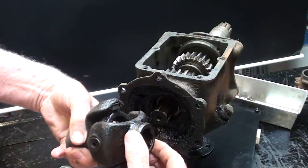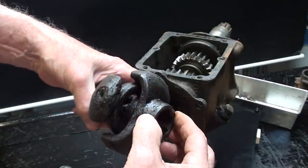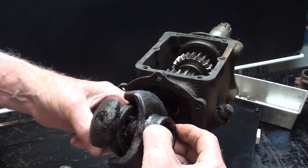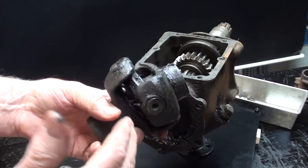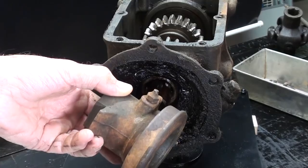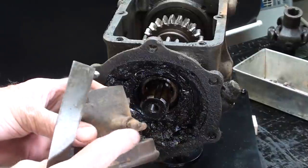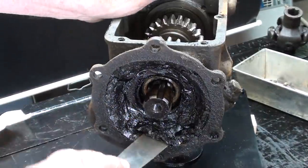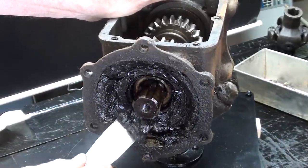And this U-joint is in quite good condition, actually. I've changed a lot of these on the old 54 Chevys and so on, and clear into the 60s. They looked a lot different than this, but you know what vibration and shudder you get when you've got bad U-joints. Over a 50-year period, generous amounts of grease were applied through this zerk right here. So as you can see, there are great gobs of filthy, semi-hardened grease right here.